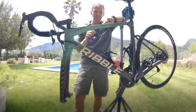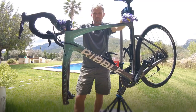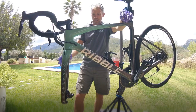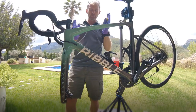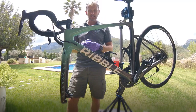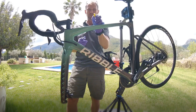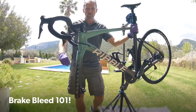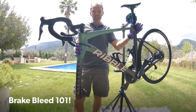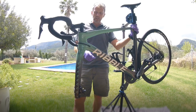Your bleed kit's arrived, you've got the correct brake fluid. So to bring you up to speed: the front wheel has been taken off, I've spread the pads back to their starting point using a pad spreader — as I covered in a previous video about pad removal. I've then removed the pads and replaced them with a bleed block, which is very important to prevent contamination of your brake pads.